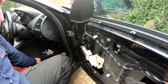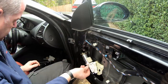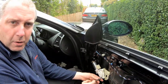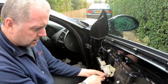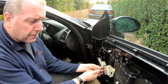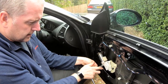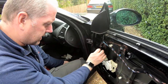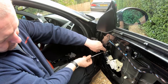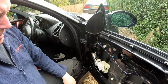It is a bit fiddly but it will go — it went in with a little bit of a pop there. Let's get these screws in to hold it in place. It's worth noting that these window regulators are sided and this one won't fit on the passenger side door — so if you're going to buy one, make sure you buy the right side for your car. The principle behind the switch is identical and they're exactly the same to remove or refit, it's just the motor is the other way around. Let's get that connector out of the way and tighten this up to make sure the motor's held securely.